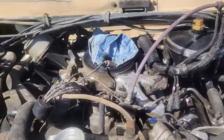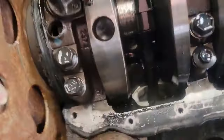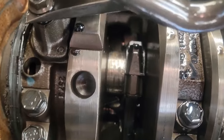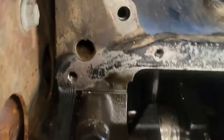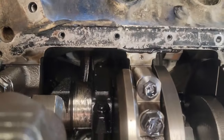I've been working on disconnecting wires and cables. I'll show you what we're dealing with underneath here. The oil pan is already off. If we look pretty close here, we can see the crank is pretty scarred up from that one missing — got oil in my hair. You can see just in there the remaining part of the piston and rod. Not sure if there's any damage to the block, but we'll see.